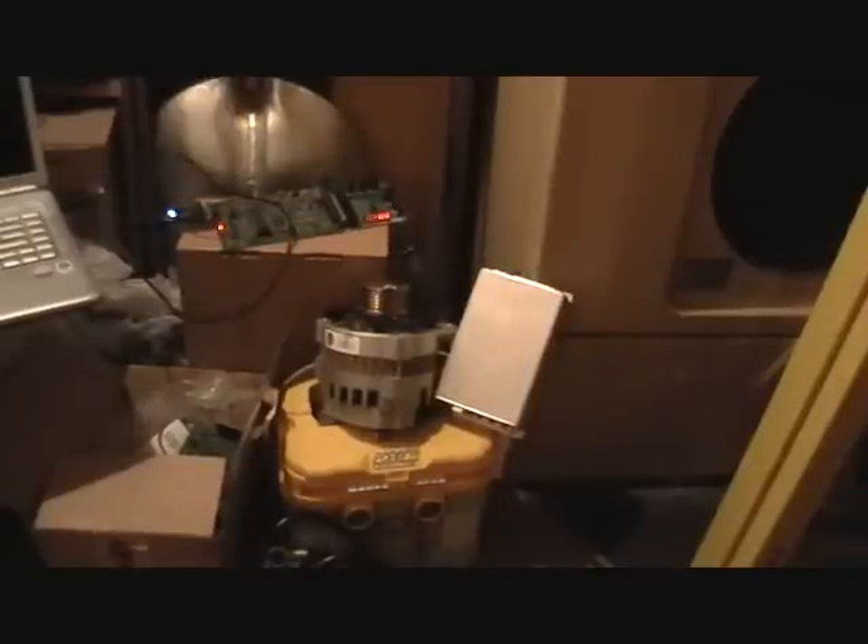Hi, this is Rob from Higher Powered H2O. I have a little war chest here for more testing on the Suburban. You see the yellow Optima deep cycle battery — this will be another battery. It'll take place alongside my main lead acid battery, and the lead acid battery will be hooked in parallel, so I'll have two batteries on the Suburban. You also see a 240 amp alternator, and the silver box is a completed MegaSquirt unit — a standalone fuel injection system.